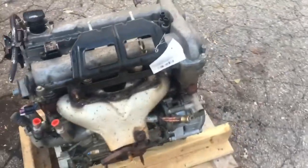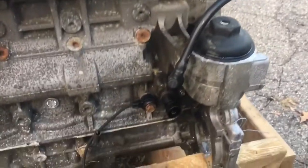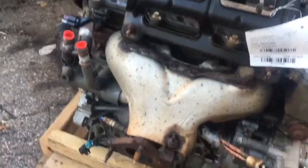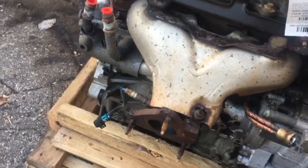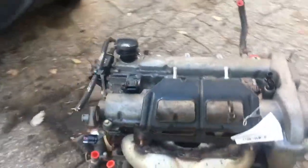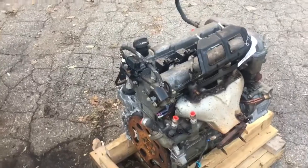This is our donor engine. If you look at the cylinder head, there's a high-pressure pump on the back that the Cobalt doesn't have. These are the studs I mentioned that are broken off on mine but present on this one. Everything is pretty much the same — even the covers are similar, though the upper valve cover is obviously different. We have to swap the exhaust manifold, and this one has a block heater we won't be hooking up. I'm super stoked about this because I'm absolutely certain it's gonna work. Please subscribe, share the videos, click the notification box — God bless you guys, and have a great day.